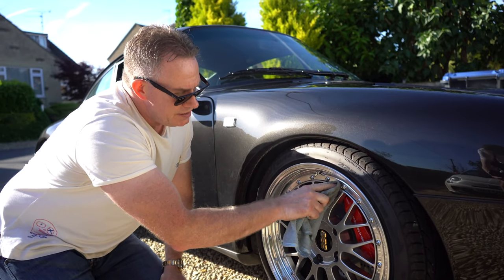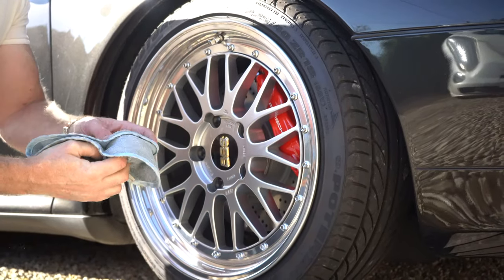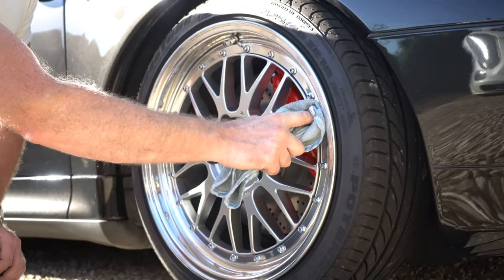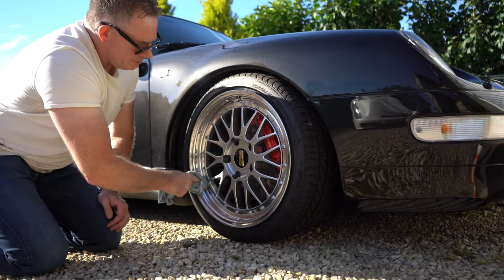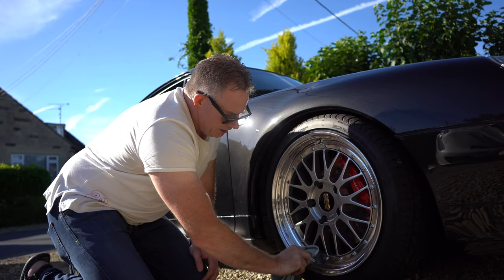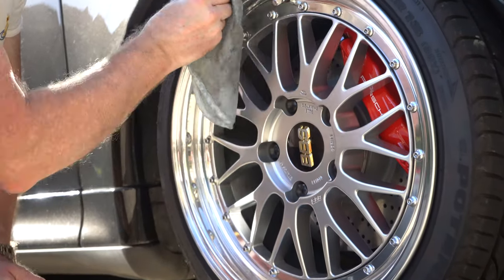When the car goes out, what I do is this quick technique: the key thing if the wheel is dirty or wet is to get moisture off as quick as possible. Get the rag around the wheel quickly and get that moisture off, because the longer it stays the more capability it has to tarnish the wheel and the more likely you are to have to polish — which takes about 30 to 45 minutes per wheel. First focus on the outside rims that aren't lacquered and are bare, then focus on the face sections. Get the rag in there with good depth so it fits inside the little slots and gets the moisture out. The fronts have a slight recess that you can really get your finger into.